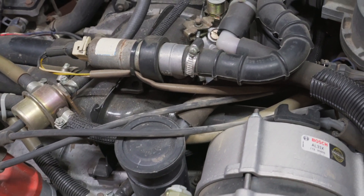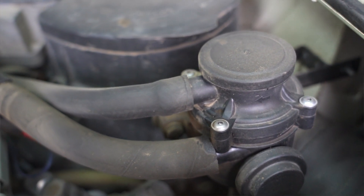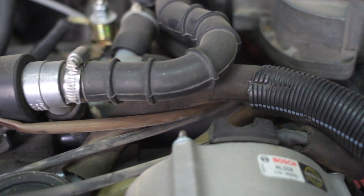After we put the engine in, I decided to put an oil separator from the breather tower to the air intake. The breather towers are kind of an odd design — the diaphragm can rip and then you get blow-by from your engine case into your intake. It'll burn back in there, but it gives you a sludgy, oily intake manifold — not only the oil, but the sludge you get if you don't warm your engine up enough. You'll notice a white sludge occasionally; it's the water vapors mixing with the oil. Those usually burn off when you run the engine at a high enough temperature long enough, but we decided to get a MAN ProVent 3. It routes the air from the breather tower into it, and basically the oil and water separate — they drop out into a little catch can, and the cleaner air goes back into the intake.